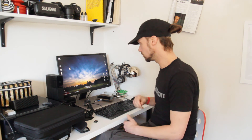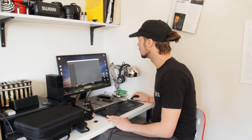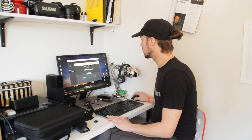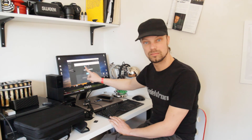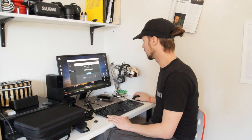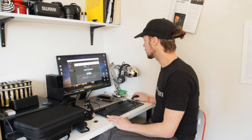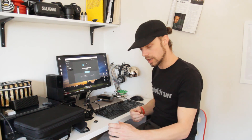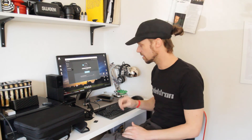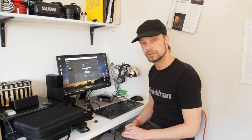Let's try it. The Quik application starts and it says 'New update available for Hero 5 Session.' Don't do that. Don't upgrade it. I will leave a link in the description where the files are. There are three files in the zip folder. Name the folder 'Update' with capital letters, put the three files in there, put it on the SD card, and the GoPro will do the rest for you. Hope this works. Have a nice day.